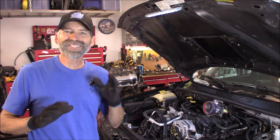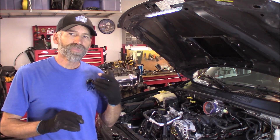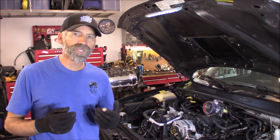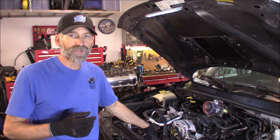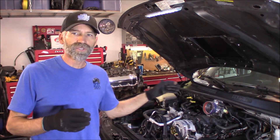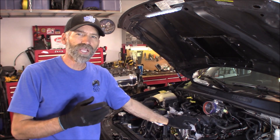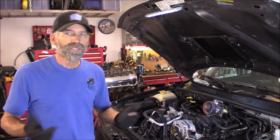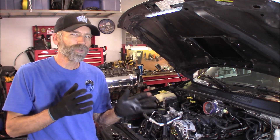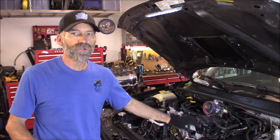Well, it didn't exactly turn out the way I was hoping for, but I did slightly suspect this was going to happen. Because I'm running an ATI super damper with a 25% underdrive pulley on the harmonic balancer down here, so everything's spinning 25% slower. Right away you're pulling down the RPM of that alternator, and it's only able to put out so much at idle. But I was hoping the higher amp alternator would do something.